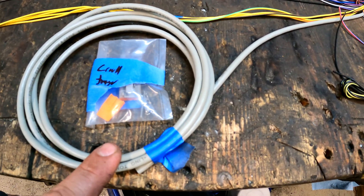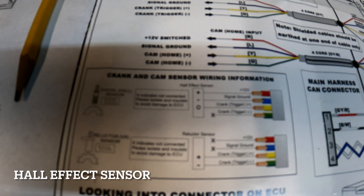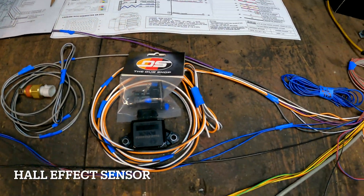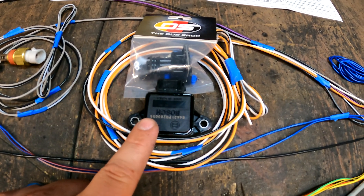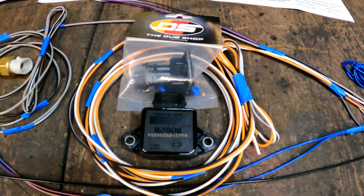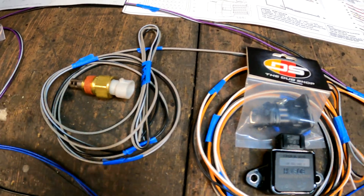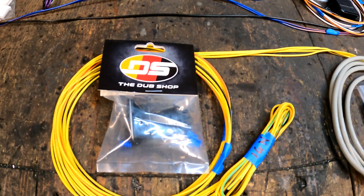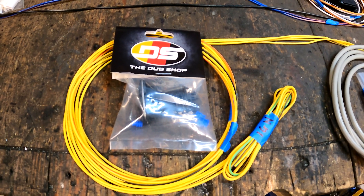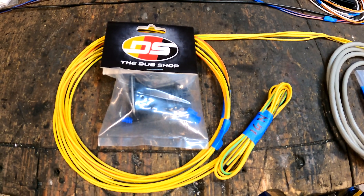As we move across the car, the next big thing is the crank trigger — here's the plug; this is a shielded wire and I need to confirm which of the two sensor types it is. Next is the TPS. In the next video we're going to have the TPS information and make the adapter plate — that aluminum should be here this week. TPS goes right in the middle, and right under it is the air intake temperature sensor that we'll run on the air box. Continuing across, here's where the coil will sit; I've left all four ignition outputs in for now.